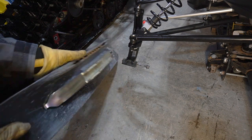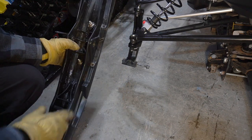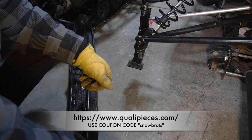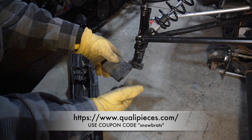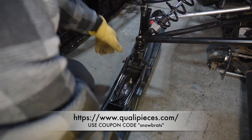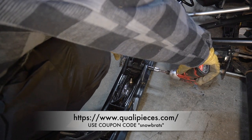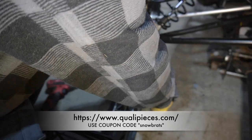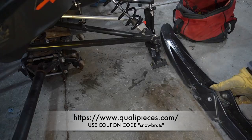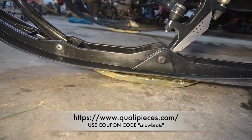Like I said, we want the shorter carbide on the inside and the longer one on the outside. I have the old dual carbide on the inside mounted so that it hides those holes. The bolt already has a nice light coating of grease on it. Put the ski rubber in — it's marked 'front' so put that back in the way it came off. Two ugga-duggas to torque — sure there's a torque spec but it is what it is. There they are, installed and ready to rock.